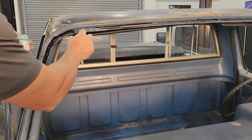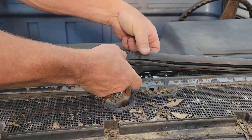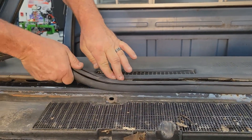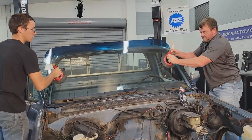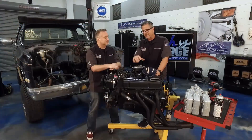Time to prime the frame — just a coat of primer around there to get it ready to accept the molding and the windshield. Then the new seal went in, the gasket, with the hook lip on the backside. They started in the center and worked their way around, so when they got to the end they had a beautiful cut right in the middle. New windshield went in, a locking strip to hold it in, and there's your new windshield. Just that easy — it really improved the truck, but I'm more impressed with this engine.